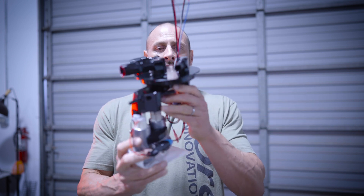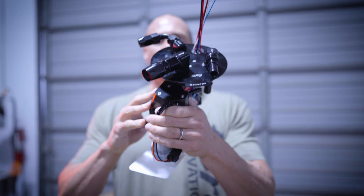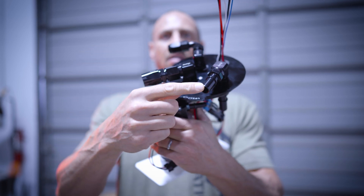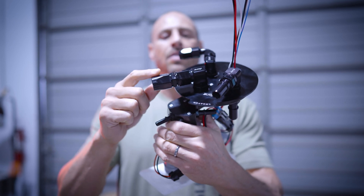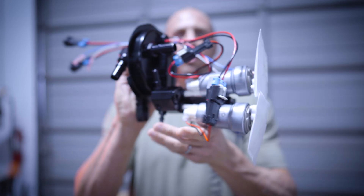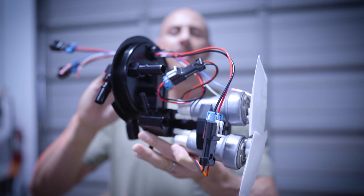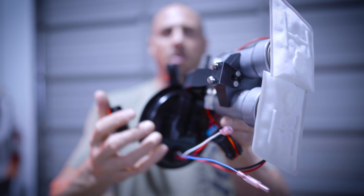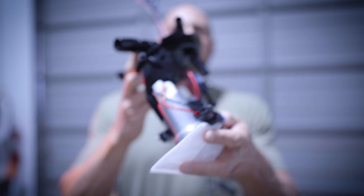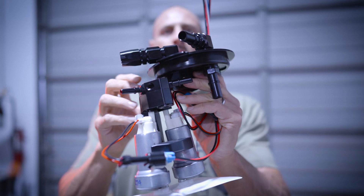Here's a quick intro of how this works and how it's configured. On the top here — this is shown with the hoses on, and this is how we're going to be configuring the fuel system. This here is for the tank vent or evap. This is the feed line. This is the return line. Going to the bottom, the tank vent simply passes through to the bottom inside and connects to the factory lines inside the tank. On the back side we have provisions to accommodate the OE fuel pressure sensor. These two fittings on the side interface to the factory Venturi jet setup.